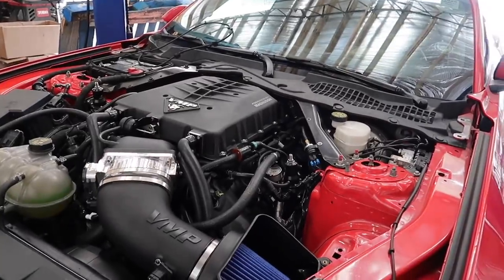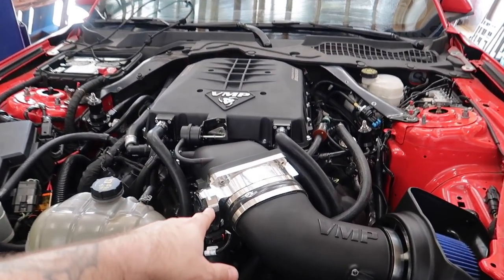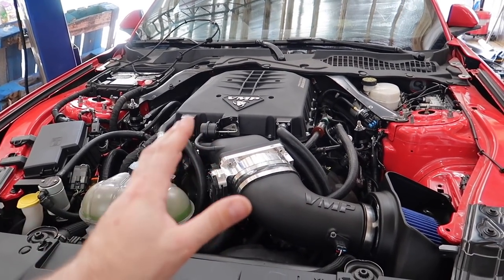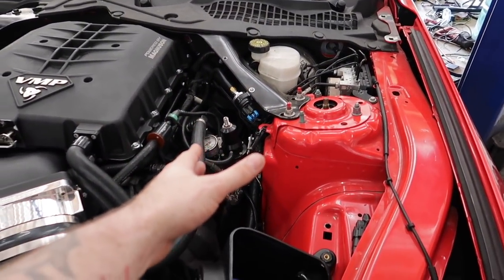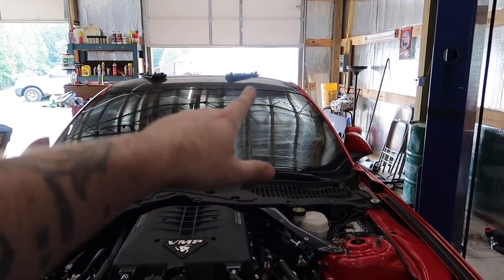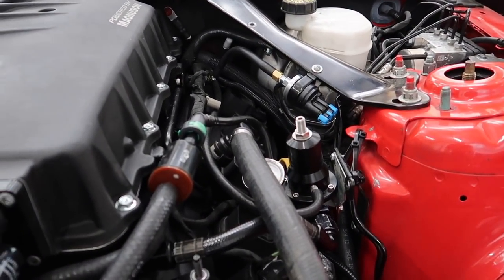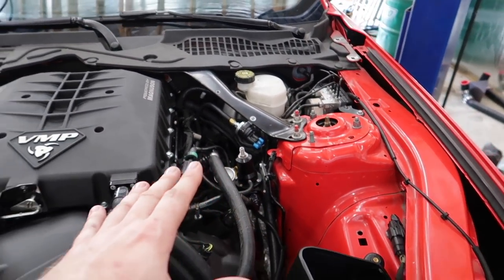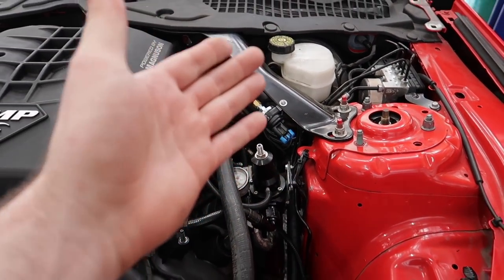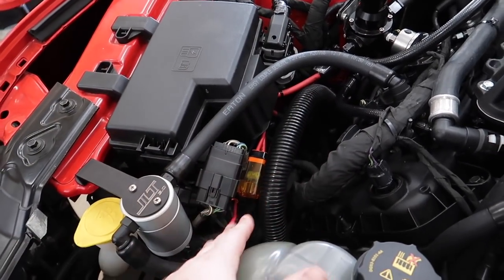We have our Lethal Performance Return Style Fuel System — same one that we had before and it works fine. We have three 267 pumps and one of them is now on a Hobbs switch, something new — a fancy cool way I decided to mount it. I tried to make everything serviceable through the car as we were putting it back together, so if I have problems I can get to it easily. Our fuses for everything down here are tucked away but still open enough to be able to get to easily.